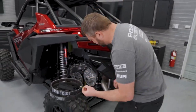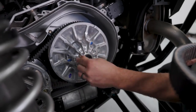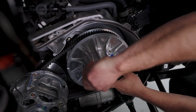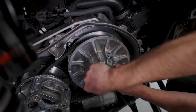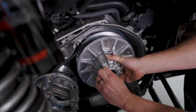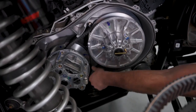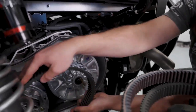The spreading tool really comes in handy here. You'll see one threaded spot on your driven clutch - start threading the tool in and it'll start getting more tension. As you keep twisting, the belt will start dropping down in the secondary clutch. The goal is to loosen the clutch enough to get clearance to slip the belt right out. Don't over-torque the tool - it doesn't always have to be fully bottomed out. Grab the belt in the middle, start sliding, and slip it right around the driven as you rotate. Then pinch the belt, shove it off the primary, and pop it right out.